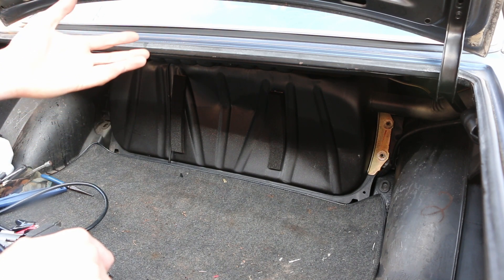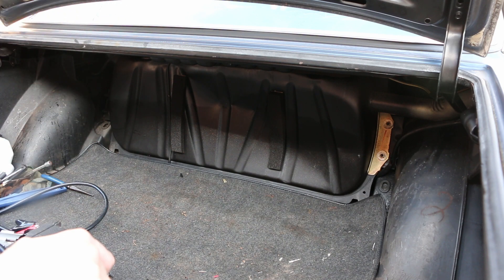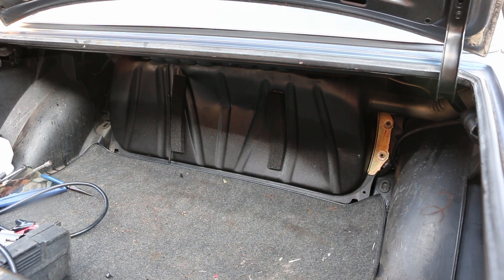This tank is in really good condition externally. There was some nasty stuff inside, but if you watch my other video on doing the tank strainer on the bottom of this, I cleaned that out. I haven't had a problem since doing that tank strainer thing with fuel quality. So I'm going to try to reinflate this tank with a wet-dry vac.